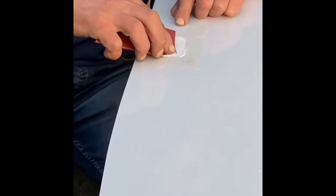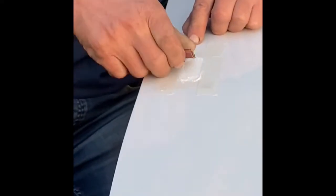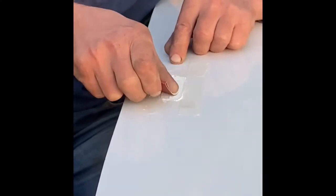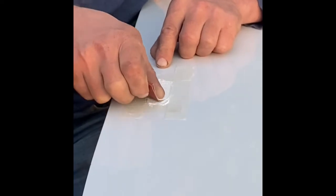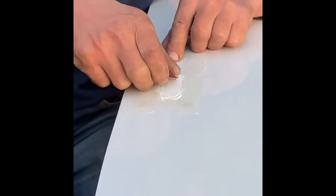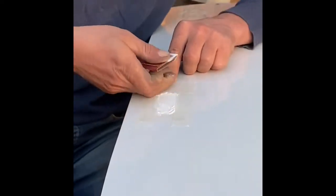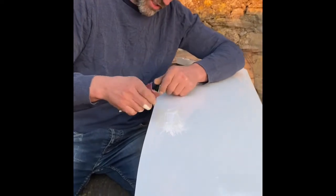Secondly, to make a kind of smooth dish surface so that the gel coat can flow into that hole effectively - a very shallow dip. And then when we put the new gel coat on, it's going to fit into that hole and we're going to be able to sand that with the new material back flush with the surrounding surfaces.